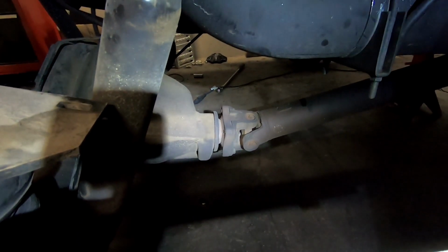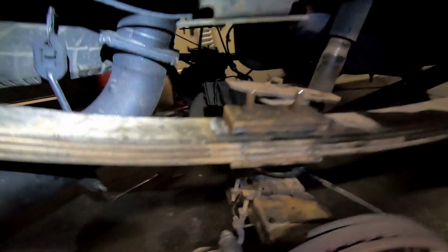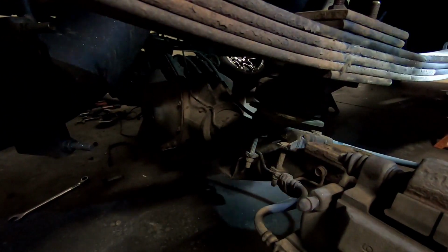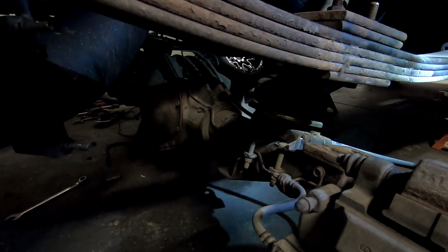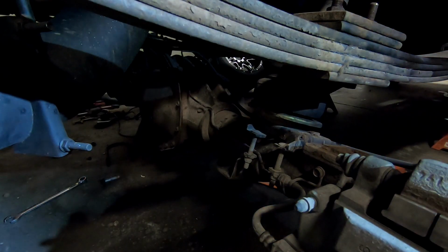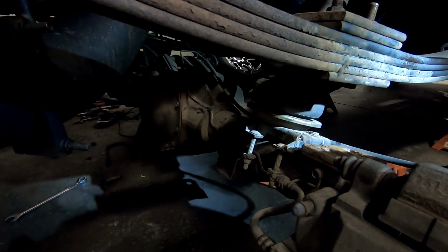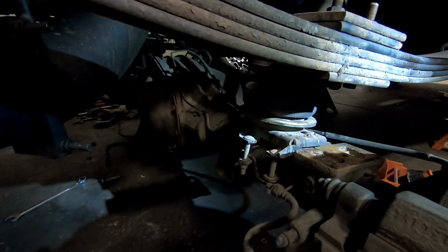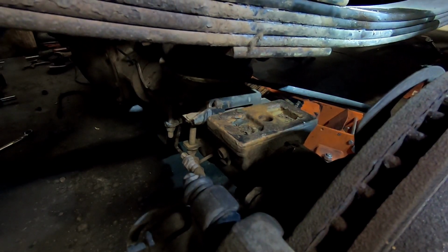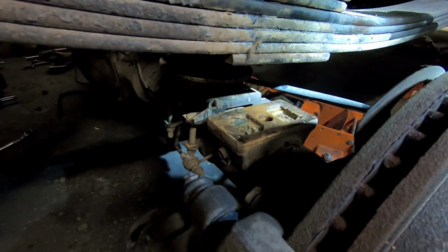Now we have to go down. The only problem you're gonna run into is the pinion slides for it. That's no big deal. I would recommend a buddy. Basically, one of you guys is going to work the jack. The other one of you is going to rake the axle forward. So the other one will work the front floor jack to try and align the axle again. All right, go ahead and go down, Mar.